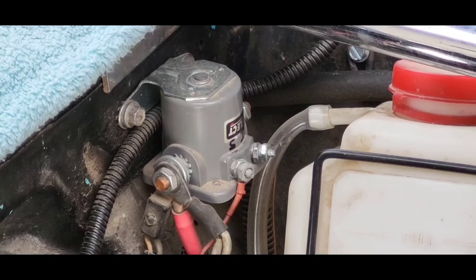I'm going to be using a remote starter switch today because I'm by myself and can't be in two places at the same time. The very first thing you have to make sure of is that your tranny is in park or neutral. If you have a manual transmission, it's in neutral as well. And chocking the wheels is a great idea. You should chock the wheels front and back. If you have a B&M shifter with a lockout for park and reverse, go to the shifter and make sure it's locked in park. Try to move the vehicle manually. I'm making sure the parking pawl in the tranny has it locked and the vehicle won't move.